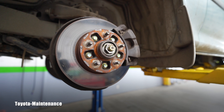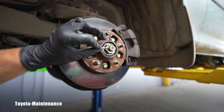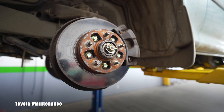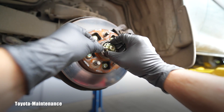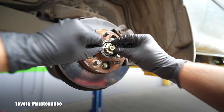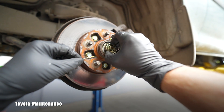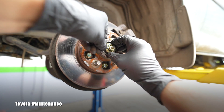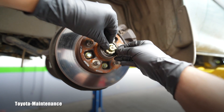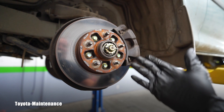Let's put the locking nut on — you can see how it works. Here is the hole opening for the cotter pin, which you didn't see before. I need to find these notches that will match it and hold the nut, stopping it from loosening. That's perfect. We will not put the cap on yet and I will not bend the cotter pin yet, because we are just confirming the fit.